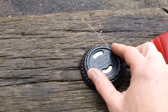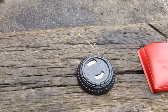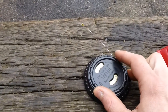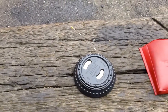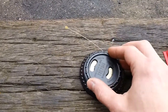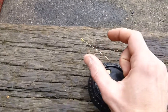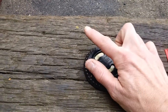Most lawnmowers typically run between about 2,800 to about 3,100 RPMs. This thing will basically tell you what speed the engine is running at without any kind of diagnostic tools or anything that requires electronics or batteries. All you do is put this on top of the machine, turn the wheel, and while it starts vibrating, it'll vibrate about a good inch and a half, almost two inches — a sweet spot where the arm goes back and forth.